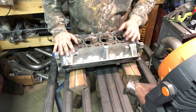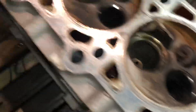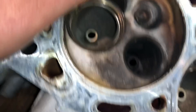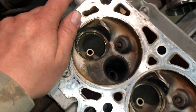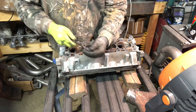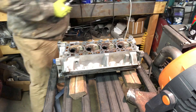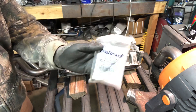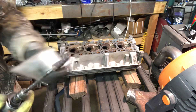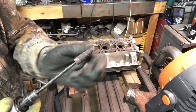We're going to do a quick clean up on these — get all the rough edges out. It will be boosted, so it won't really matter a whole lot, but I just want to clean it up for them. Then we're going to take these to the engine shop and have them reassembled with new valves and a higher spring rate valve spring. We're going to do a time lapse on it. You can get these at Eastwood — that's where I got these. I'll put a link in the description. They're just sandpaper rolls; I have the cones and the drums. I'm going to start with the cones first.